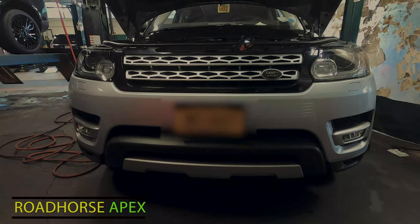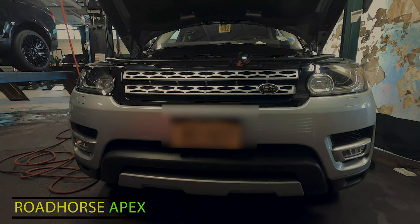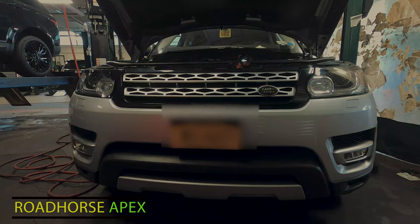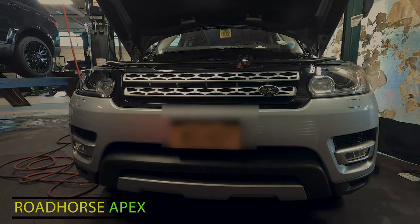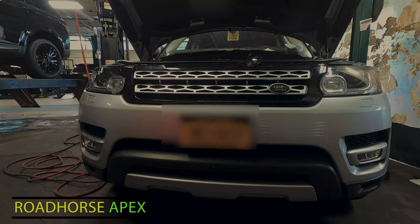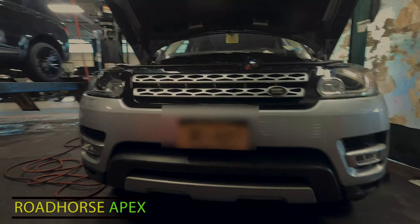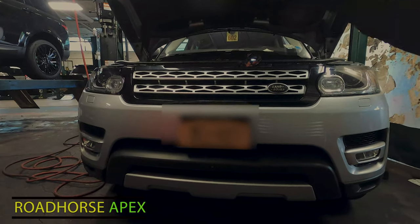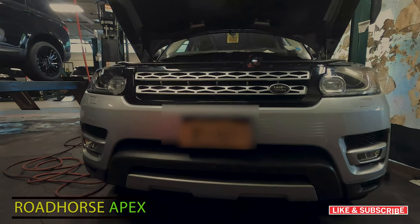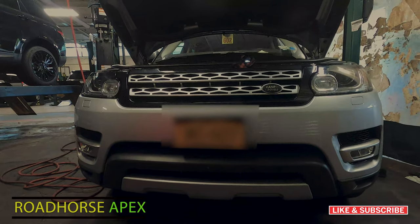And now, guys, I want you to see that this vehicle is gonna drop and raise up. Just give it time and it's gonna do it. Hopefully we can capture it. I really want you guys to see this. There we go. You saw that when it rose up just now? That's the reason that spring is causing the compressor to overwork. So we definitely need to change that air spring before it causes the compressor to continually overwork.